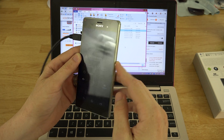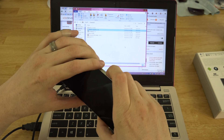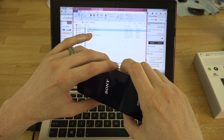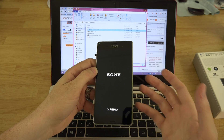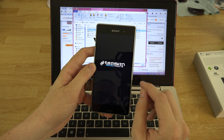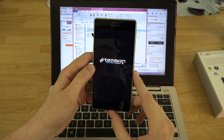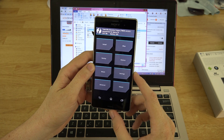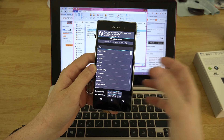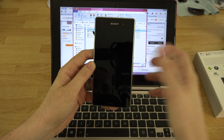SuperSU is now on the Z3. We reboot the phone and repeatedly press Volume Up and Down simultaneously until we get to recovery. It vibrates — that means we can stop the back-and-forth, which is correct. We're in TWRP. We go to Install, and now our data is there because the phone reset after bootloader unlock. We select the SuperSU zip, swipe to install — done. Reboot system. This phone is rooted!